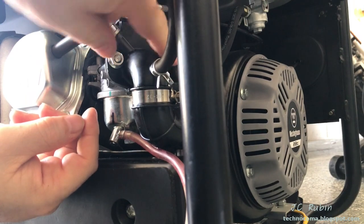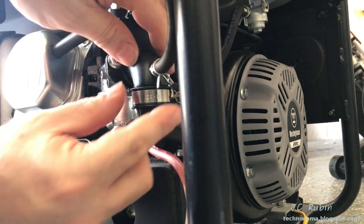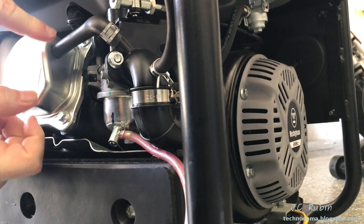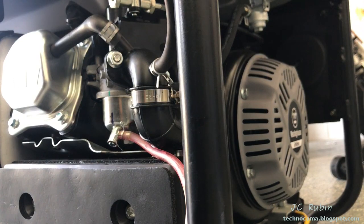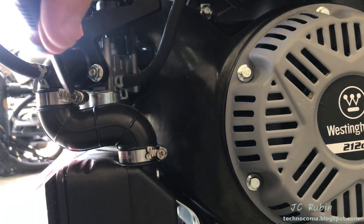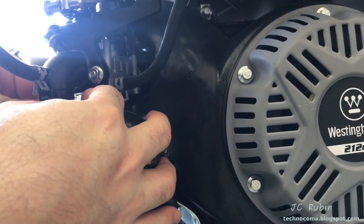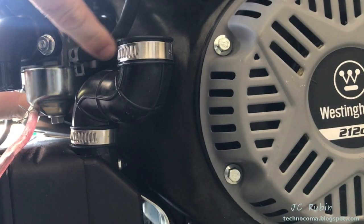Intakes are generally similar on these setups — there's some sort of manifold coming up in front of the carb from an air filter. There are a couple of fittings: one from an emissions tube, which is the crank ventilator. There's a clamp connecting the hose from the air box to this manifold, so I'll loosen that clamp. We can see two clamps on this S-shaped hose going to the air box below — I'll loosen those too.